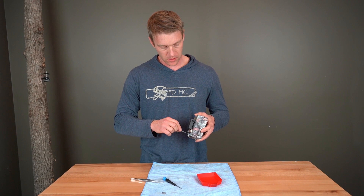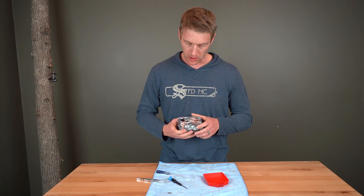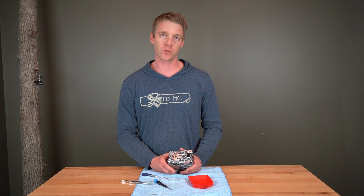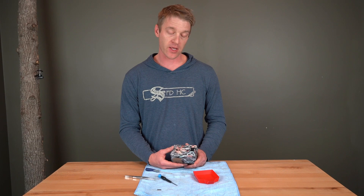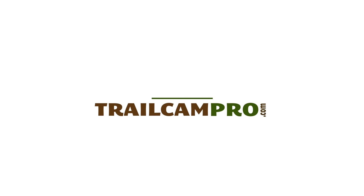I'm just again snugging these screws up — they don't need to be too tight. Once I've confirmed they are all in there at the pressure I like, we should be good. What I would simply do is check your PIR again and then take it outside for a walk test, just walking back and forth in front of it. Hopefully if everything went according to plan, it worked. Well, hopefully this helps and good luck if you perform this surgery. Just be sure you don't do it while you're in a rush — take your time, make sure you don't break anything. If you have any questions, you can always give us a call at 417-429-4915. And if you're looking for a new trail camera, check us out at trailcampro.com — we offer a two-year warranty on all our cameras, a 90-day return policy, and customer support. We will see you soon, thanks for watching.